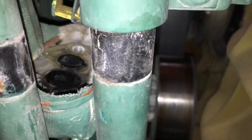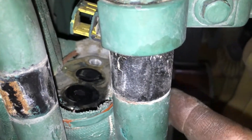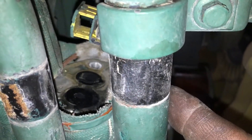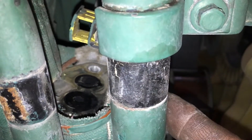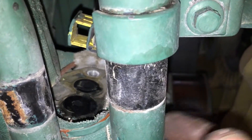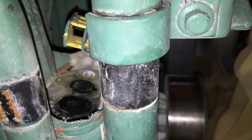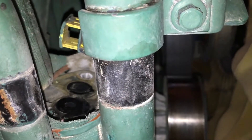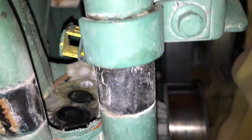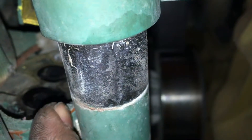There are two ports down here — you'll want to check those to make sure they're not plugged with soot. You can do that by blowing some air in there or putting something bendy like a skinny straw in there to make sure they flow through. You should get more than an inch or two of whatever device you put in. They're at an angle, so be careful.